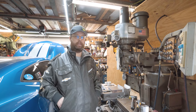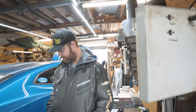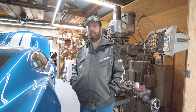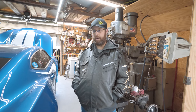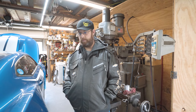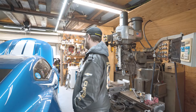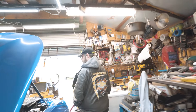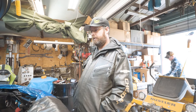That's a pretty cool system. Is this the first COPO to have one of those? I don't know — I thought we might be the first ProCharged one, but Gas Monkey did a ProCharged one a few years back. That was a fifth gen though — I think we're the first sixth-gen to go ProCharged. I'm afraid we're going to tear up belts to start with, and we've got to get rid of the water pump and go to an electric one or a remote mount water pump.